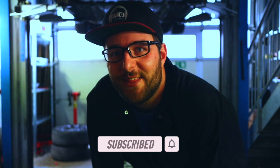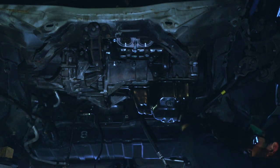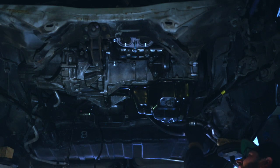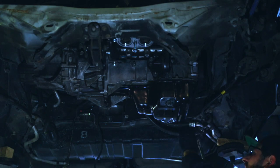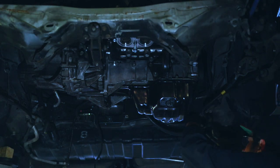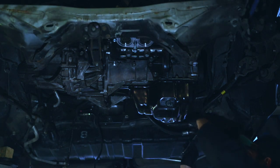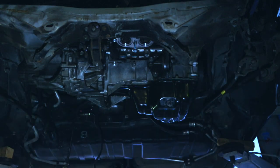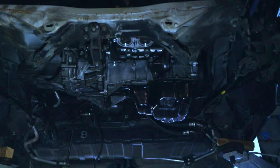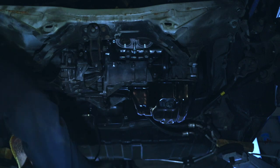The engine is in the bay! After this big victory, I kept moving with good spirits and decided to hook up the aircon hoses underneath. This always amazes me — we have a totally different engine in the car, but we could reuse the stock 1ZZ air conditioning and the hoses bolt straight back into the chassis of the MR2, which would give me a functioning air conditioning. It's a race car so it's not really useful, but I was a bit lazy and just wanted to keep the same accessory belt. It's well possible I might delete it in the future.